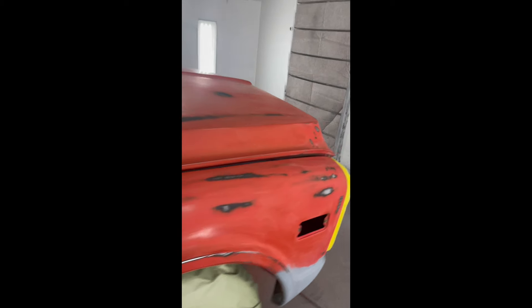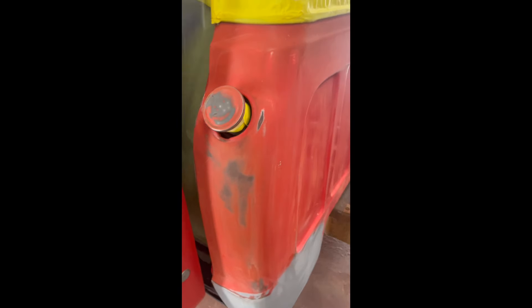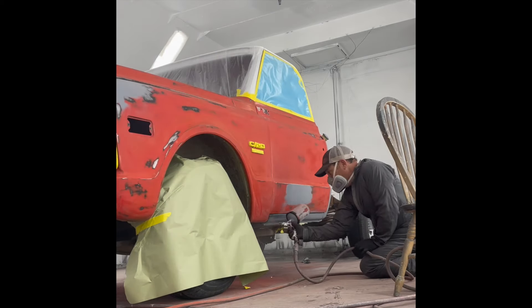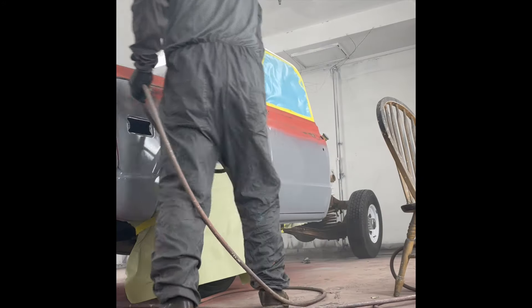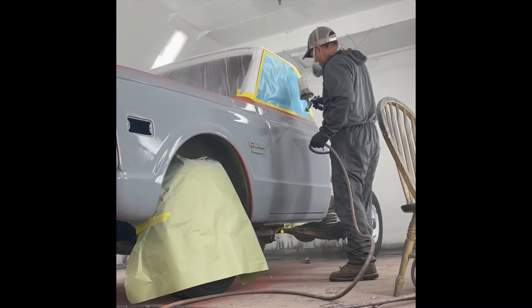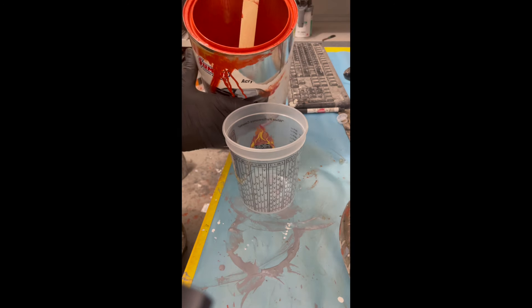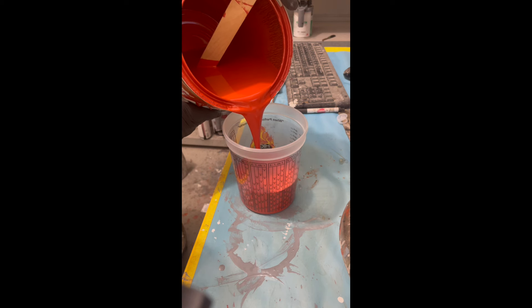Alright, so here's the cab. It's going to be painted orange with the Summit paint. I'm going to seal it first. Disregard this — it's not really what we do, or this way of doing things. It's just a time-frame thing and it's mine, so there. Getting ready to cover the cab now with the Summit acrylic urethane. It's a 4-to-1 paint, single stage, acrylic urethane.